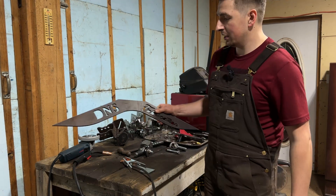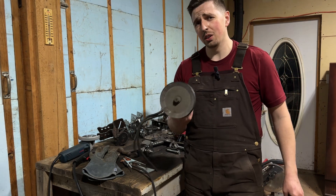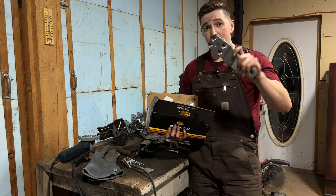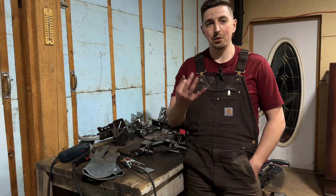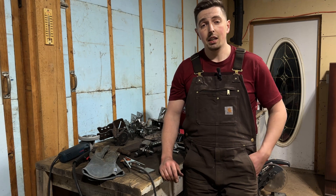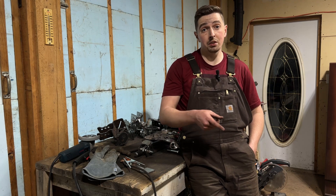I have also started on the trucks — this one is a test run with some of the printing in it, it didn't go exactly as planned so I need to run another version. Some other things happening this week: collecting parts for the front suspension. Nigel from the Toyota TDI build was able to get me a power steering pump for a 22RE — thank you very much. We've also been collecting three-link parts: I got Trail Gear high steer arms, as well as the drag link and the tie rod. On top of that, I've collected three different double-cardan Toyota drive shafts — two rears and one front — and we're going to look at those, cut a couple up, and throw them on the lathe to balance them. I need to shorten one and potentially lengthen another, and I'm also going to be getting some Toyota to Suzuki driveline adapters to meet up to my transfercases.